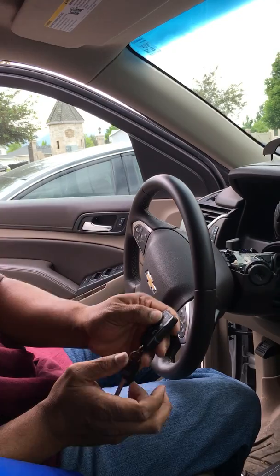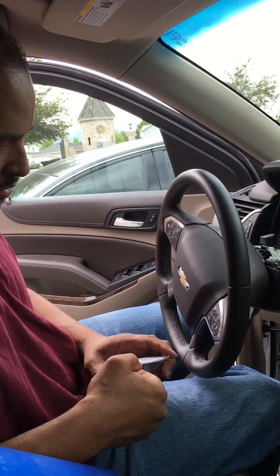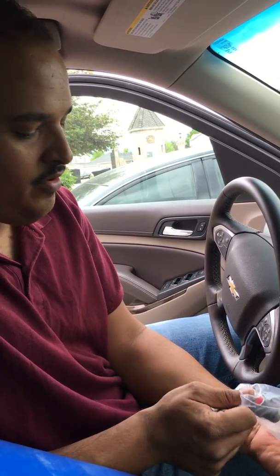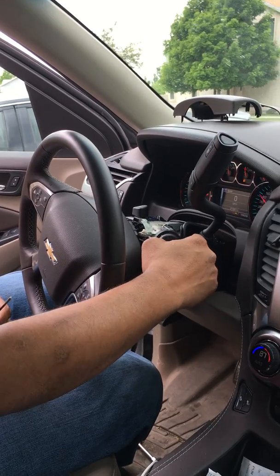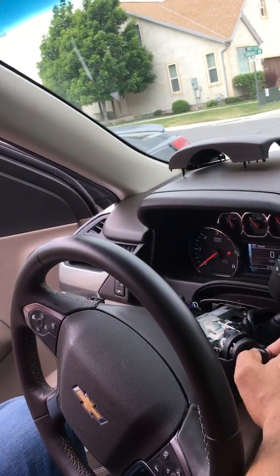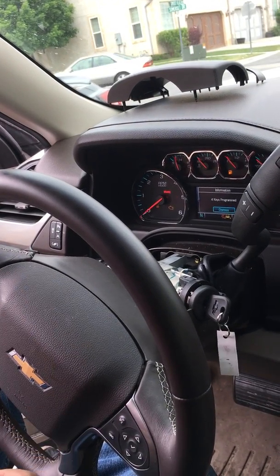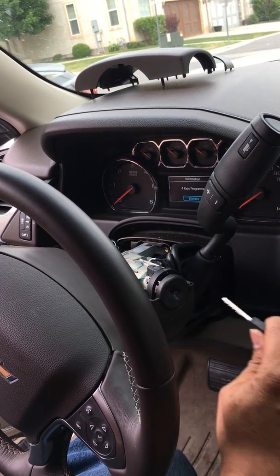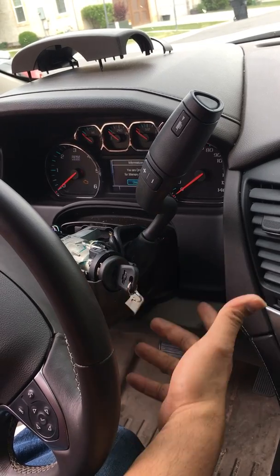The remote control for the car is still going to be the same. Whoever has the spare key currently still has a remote to unlock and lock the doors, but they won't be able to start the vehicle and take it unless they go through the hassle of breaking the column — which I don't think they're going to do. To program an additional key: turn the key to the on position until the theft light goes out, then stick the new key to be programmed in, wait for the theft light to go out, and now it says two keys are programmed. Now I have two replacement keys that will start the vehicle.